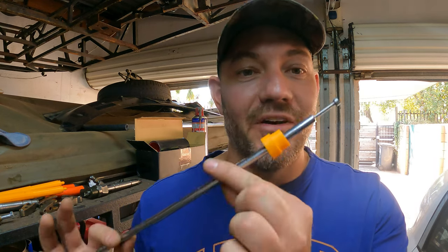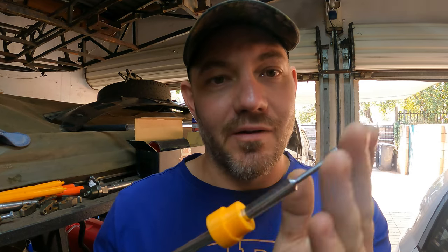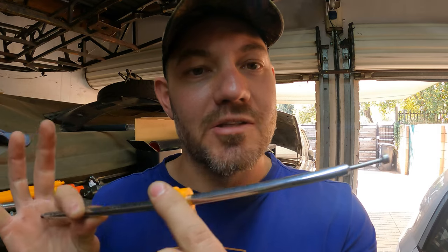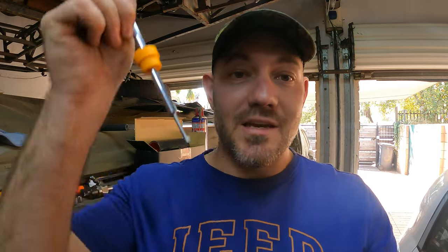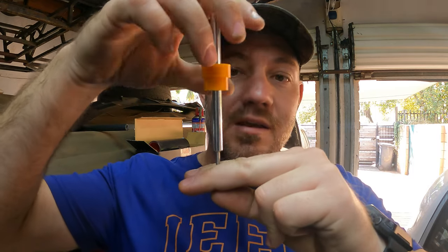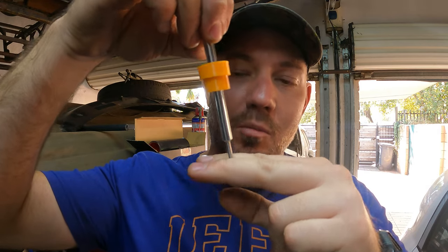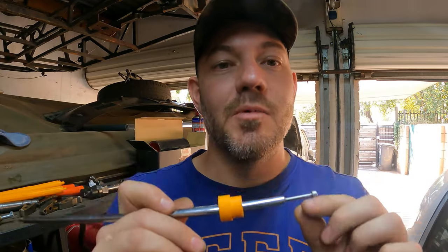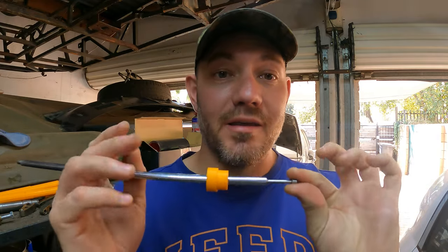My third and final design. Quite easy. I found this chrome rod — an 8mm rod. Works perfect. I machined this down on the lathe, so it looks like that. And then I've got this 3D printed part that just goes up and down. The idea is I go into the head, hook it underneath the head, plunge this in until it can't go any further, take it out and measure this distance — and then I can determine the cylinder head thickness at the moment for each cylinder.